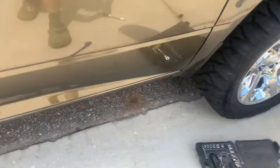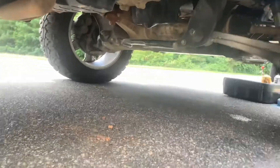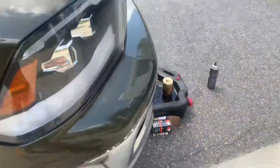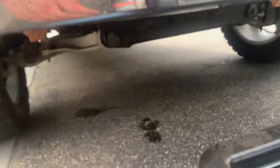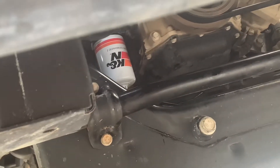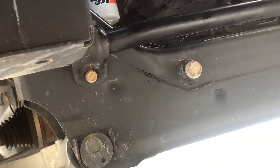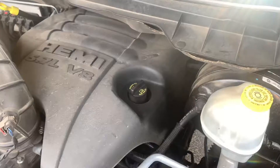One thing I like to do is double check — make sure the drain plug is in there, and also double check that my filter is on good. Because you really don't want to start adding oil and just leak it all out. You can see the filter's in there. Wipe around it so that if it does start leaking we'll know. Always go back through and clean everything, because once it's clean, if it starts leaking you can tell — it's fresh fluid on there.